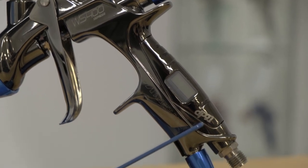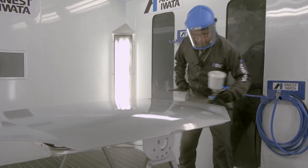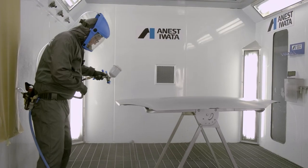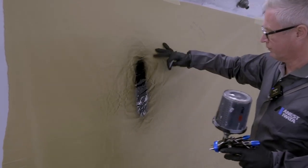If we move on to the WS400 base coat, this is where there's been lots of changes and lots of development made. With the introduction of more paint companies going on the wet-on-wet application, one coat performance base coats, we realised that the compliant version of spray guns is where a lot of focus seems to be made. Over those three or four years of travelling and experiencing all these different kinds of requirements, we looked at the WS base coat gun in more depth, understanding the need for different variations of compliant nozzles and caps. We looked at what we used to have in the past — a standard OBS base coat application — and people used to complain that the pattern was too long, too thin, and it used to split in different kinds of conditions. So we focused a lot of time in this area.